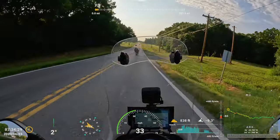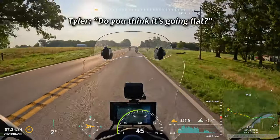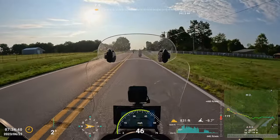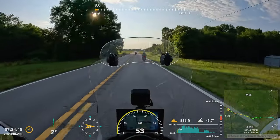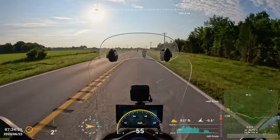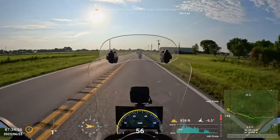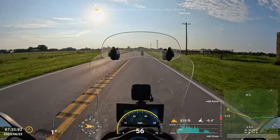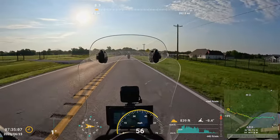Yeah, I can feel this rear tire is a bit squishy. It's low. I don't think I've got a puncture or anything, but it feels like it's 4 or 5 pounds low compared to where I usually run it. I noticed it when I bumped over that curb, but back there right before we were taking the pictures, it felt springy, bouncy, squishy. I just did the squish test on it with my thumbs, and it was dipping in a little bit easier than it should. I think I've got about 30 pounds in it, and I usually run it at about 34 to 36. Just feels different.